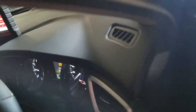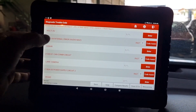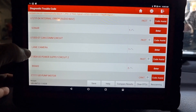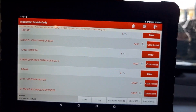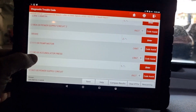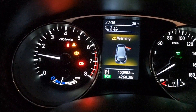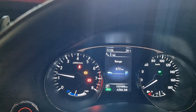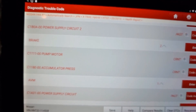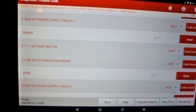I hooked up the scan tool and after the health report I'm seeing an internal error in the audio navigation system, an error in the sonar, and an error with the power supply and the lane camera. But that's nothing — the customer didn't mention those, he's just complaining about the brakes. I'm also noticing two warning lights, and there's a little whistling noise that never goes away. The scan tool shows codes C1111 pump motor and C118E accumulator pressure.